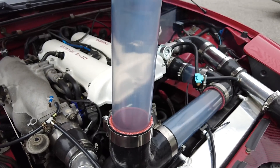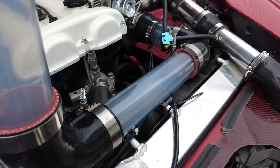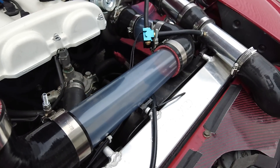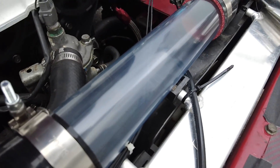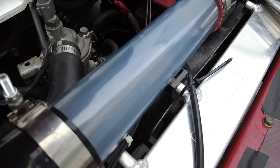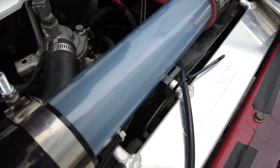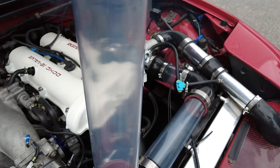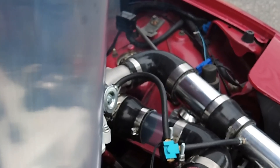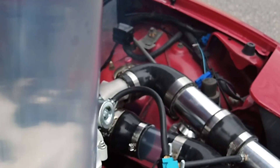The first really cool thing I noticed was just how thick that fog was in the intake — this really allowed me to visualize the air going into it, and I was super happy with this. The second interesting thing I noticed was that air was coming out of my blow-off valve at idle. This means that at idle there was enough vacuum at the intake manifold to be pulling the blow-off valve open and allowing air to escape through it.